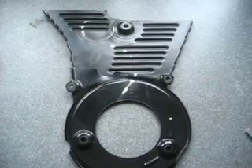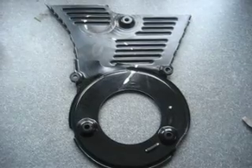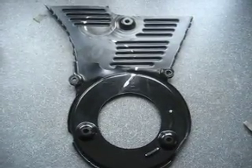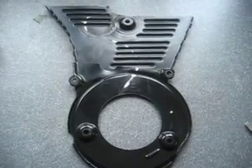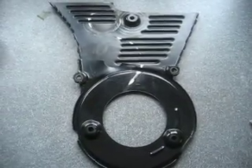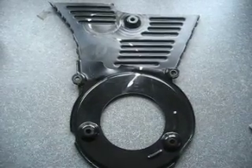It's good to have verification that what you're fixing is what's wrong. Once again, change your timing belt and always change your water pump. Side note: even though that water pump dumped all of its bearings, it still continued to function — if it hadn't deviated so much from its center sprocket position, it would have continued to work.